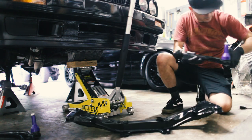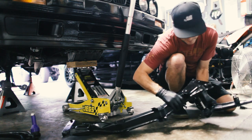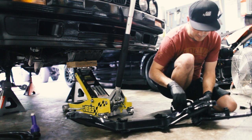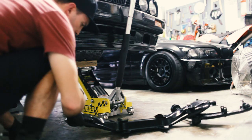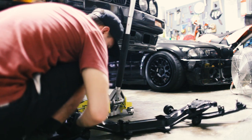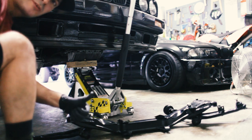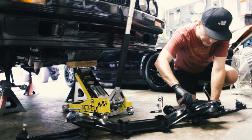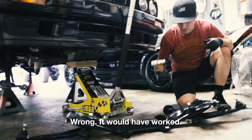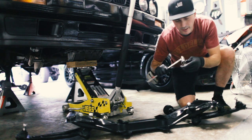So here's our front subframe. I'm going to take off these locking nuts, pop off those suckers, slide that on right there, and just hand-tighten it for the moment. These have to be torqued to 61 foot-pounds, and since my good torque wrench starts at 70 foot-pounds, we've got to use this ancient thing — but it still works. It's a 22-millimeter socket.